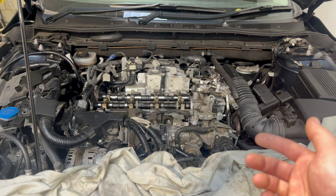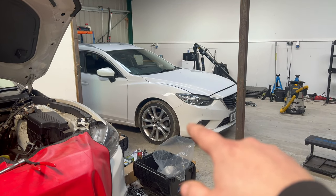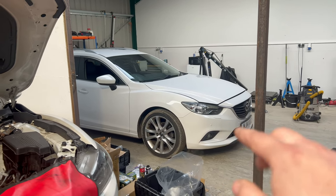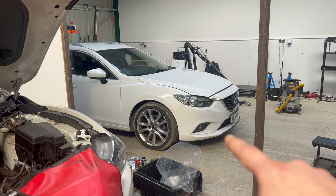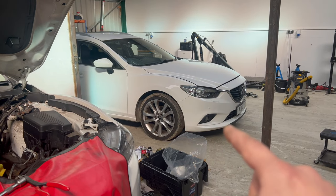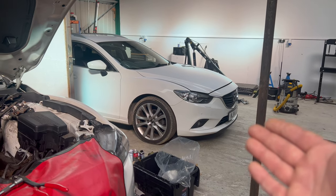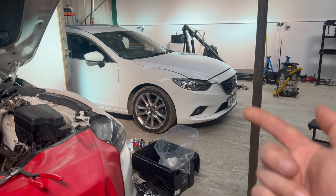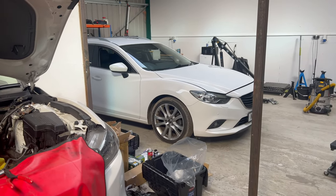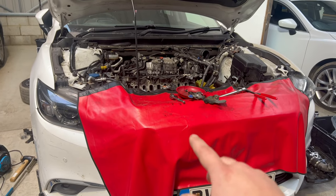The third car had an exhaust camshaft inspection done and it turned out the exhaust camshaft is worn. I contacted the owner and he said go ahead, so we're going to replace the exhaust camshaft and clean the cylinder head. I also recommended dropping the oil pan to check it. We won't replace it without checking first - we tell the owner what we find and he decides. If it's blocked, we recommend replacing it; if it's clean, we put the pan back and test the car.